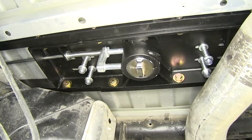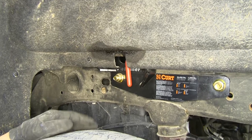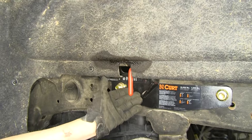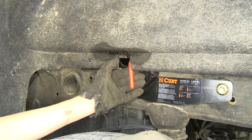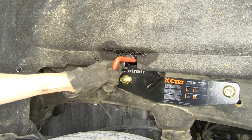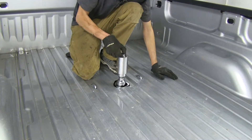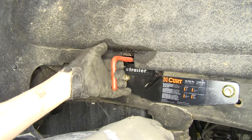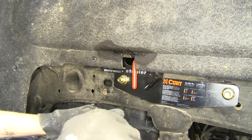Now I'm going to go ahead and retract our handle and you can see how the ball is secured. On the driver's side of our vehicle we'll find our handle that we can use to remove our ball. When you want to remove the ball or flip it upside down for storage, you grab the handle, pull it out until it stops, turn clockwise and it's locked into place. When you're ready to have the ball flipped over or ready for towed position, just grab it, turn it counter clockwise and release it. The spring loaded action will lock it into place.